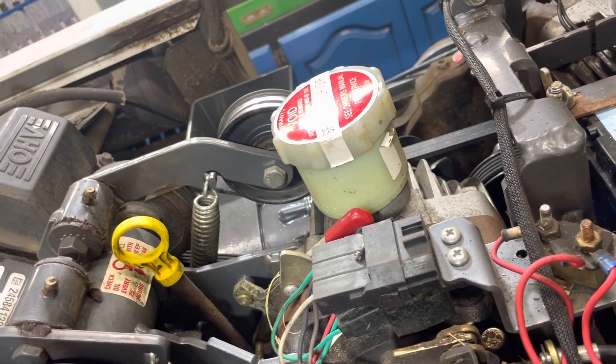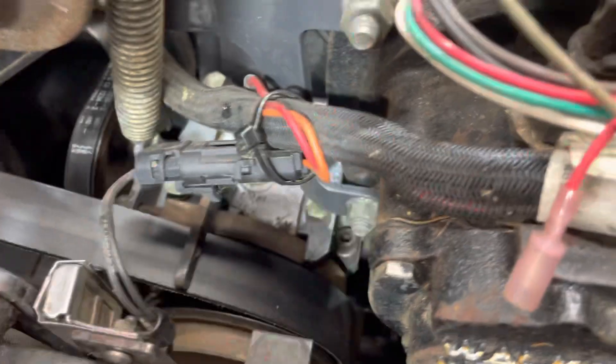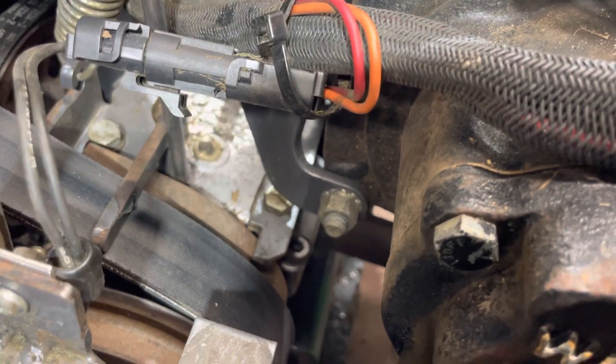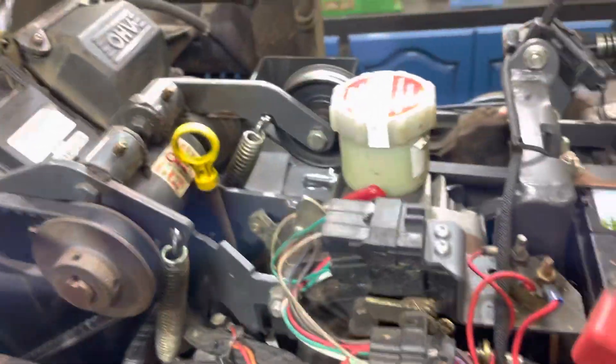After I got all that fixed with the blower and I'm running it, I smell the belt burning. So I put all brand new belts on it. But if you look, there's a brake right around this transmission — that band. There's a brake band right there where the end of that screwdriver is. That is your transmission that runs the blower and the drive shaft out for your front deck blades. So I went to lift this handle up and it worked stiff — there hasn't been grease in it. It wasn't engaging, and then the belt started burning.